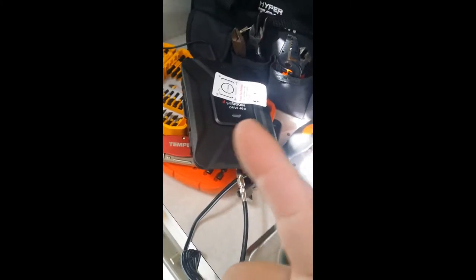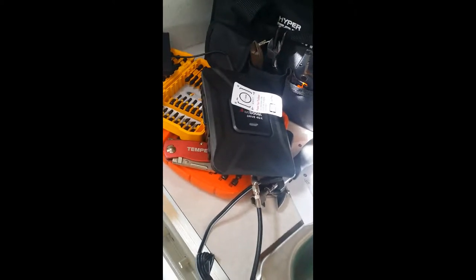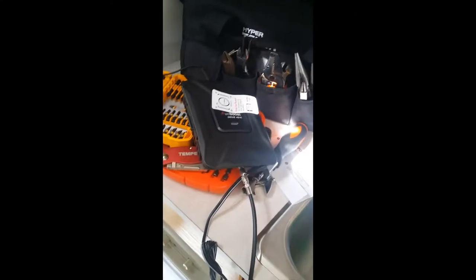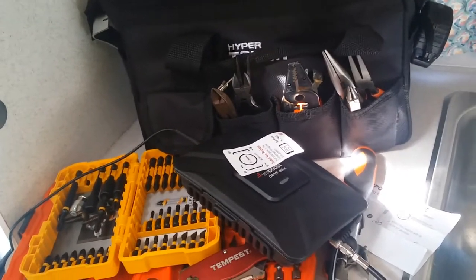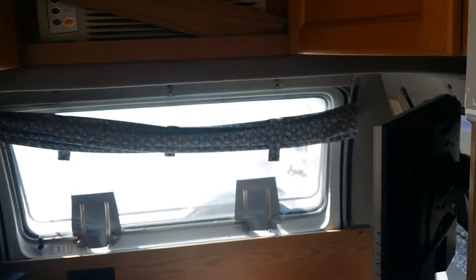When the booster is off there's no green light on it. My download speeds inside are about 0.5 megs download and almost 0.4 megs upload. When the light turns on, my 2 bars of 4G goes to 3 bars of 4G, my download speed goes to almost 4 megs down, and I get almost 5.5 megs up. That is incredible. I'm incredibly impressed with the WeBoost Drive 4GX.